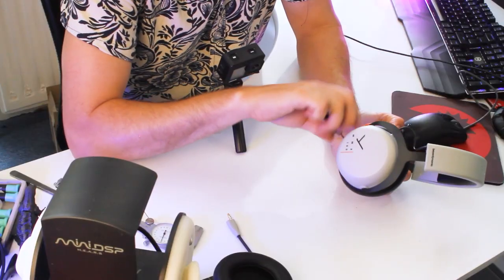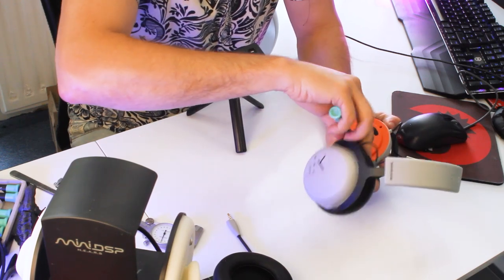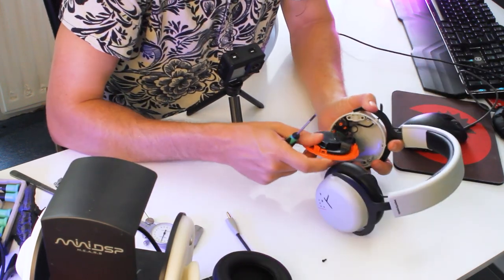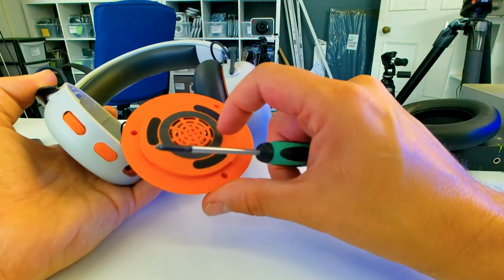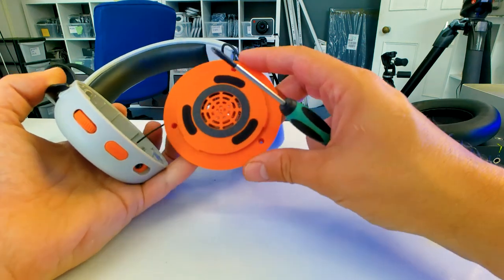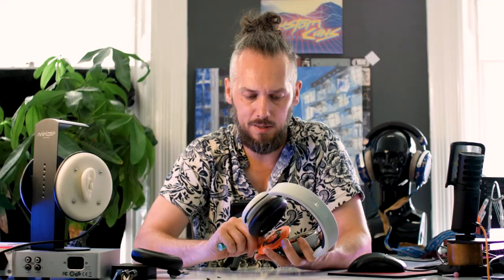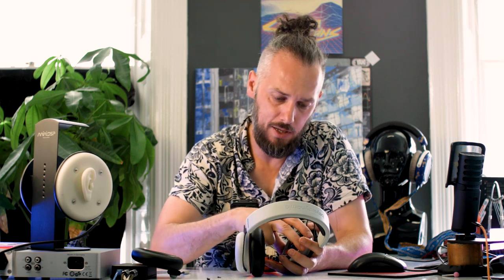So you've got three screws under here. On their Pro range and audiophile range, the driver tends to be clipped in with a retaining ring rather than screwed in, so these have got screws instead. Inside we've got a separate little enclosure - that's the actual driver. You've got a bit of felt around the outside which will help with some edge diffraction, and then you've got acoustic silk over some vents, which again will be to do with tuning. The advantage of having a little separate enclosure is it means it doesn't matter what you put in here - you've got loads of circuit boards on one side and not the other. Because most of the tuning is done in this little enclosure, you won't have an imbalance from left to right.